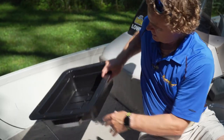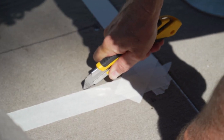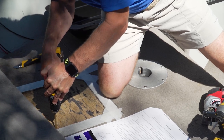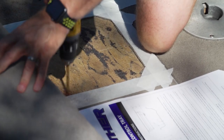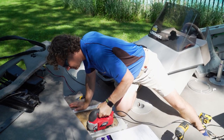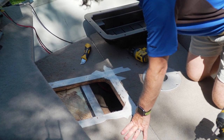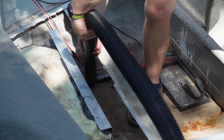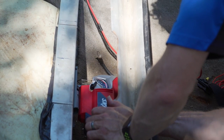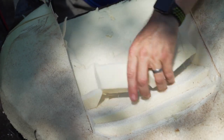We've got to cut with a utility knife inside to remove the carpet. Now that we've cut the carpet out, we've just got to make a pilot hole for the skill saw. Time to cut the template inside the tape. With the hole cut, we now know where to remove foam, so we remove the deck and tidy up a bit. About 10 inches of deck support had to be cut to fit the tray. We also had to cut out enough foam to fit the tray, which definitely makes a bit of a mess.